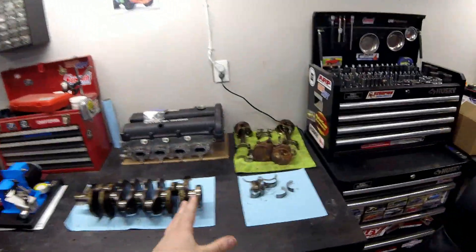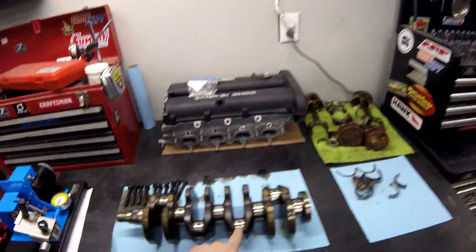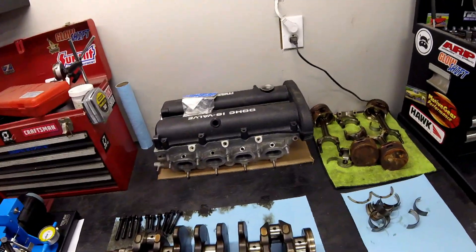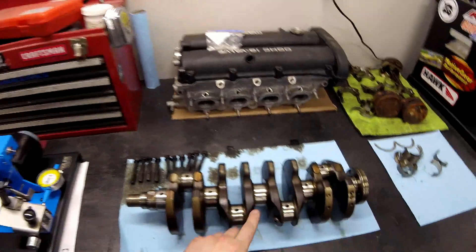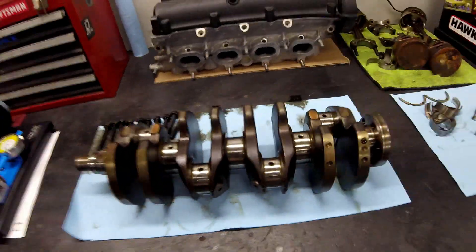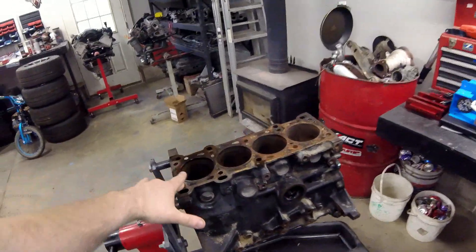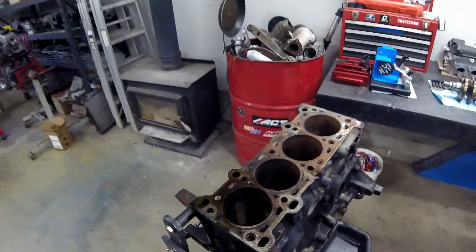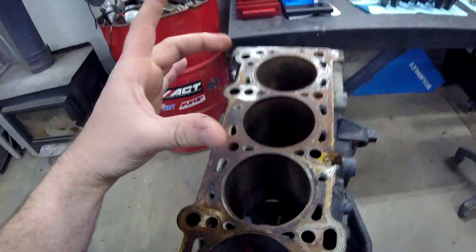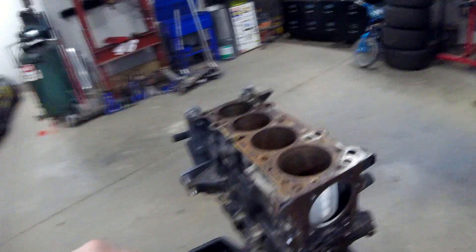When building a forged motor, we're getting new pistons and new rods, so we don't care about the condition of those parts. We're getting new bearings as well. The crank can easily be turned down if there's a minor defect in any of the journals — you can get an oversized bearing. A small nick is not really an issue; we can just turn it down and get different bearings. For the block, the only thing you're really looking for is major cracks and scores in the cylinder walls so deep that you can't overbore. This one was fine. We're overboring to 84mm pistons, so a couple of small scuffs are not an issue.